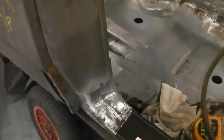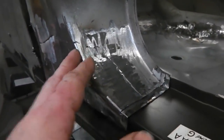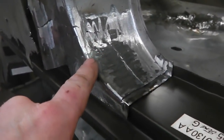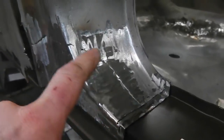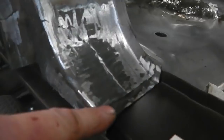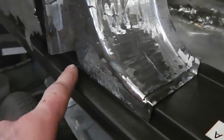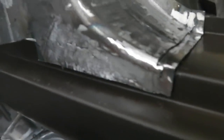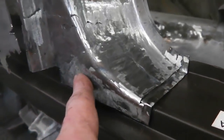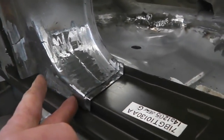Right, now then, I've just time warped you. I left you trying to fix this. So we got a piece of the front A pillar, grafted it into the B pillar, put a lip on it here, so it sits on the sill, and it's worked. Extra bit at the bottom, nice and straight. So that gives us the repair for the B pillar, and it fits.